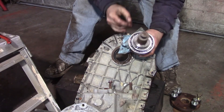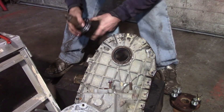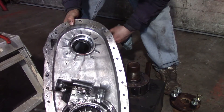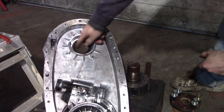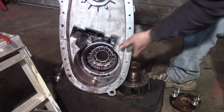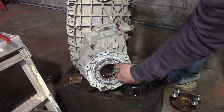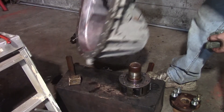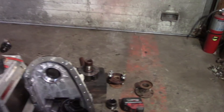That's the output to the front axle and there's a snap ring right there. We're going to replace that bearing — take that off and it slides off. That's all the disassembly. If you were going to rebuild it, now would be the point where you'd go back together. We could not get the seal out and we could not get the bearing out — you'd probably have to destroy the bearing to remove it because there's no way to get to the outside race from behind.